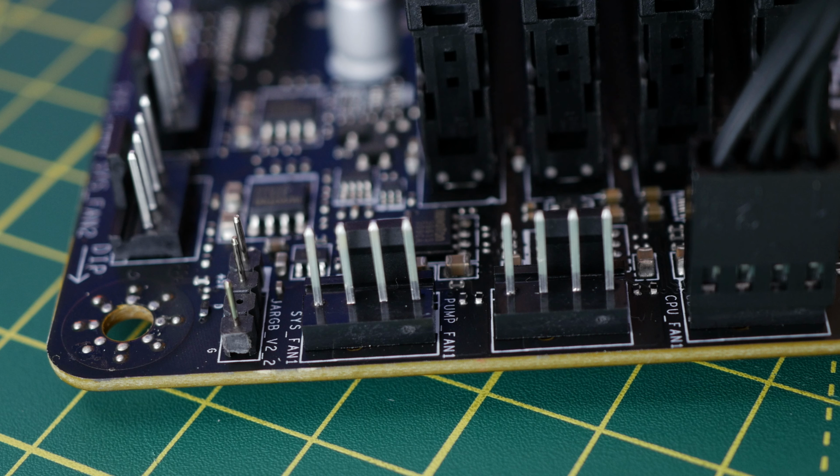You plug all the fans into it, and then again you plug in the same sort of cable logic. So you've got your 5-volt RGB header and a system fan header controller in there. Plug those into your motherboard, and system power from the power supply unit as well. And then you can control all the fans, lighting and RGB from this one box.